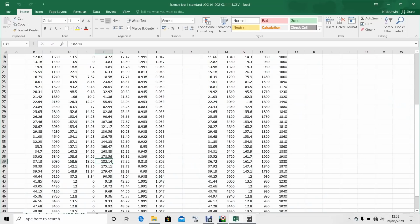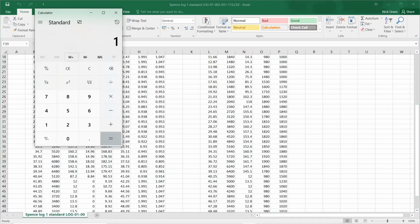Airflow peak at about 180 there, so 180 divided by 0.8. 225. Perfect. Standard fine power. Who would have thought? So the math is reading that 180 g/s, which translates to 225 perfectly, using the 0.8. I know it's ish, but it's a bit mad how it came exactly 225 there, isn't it?